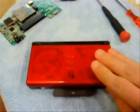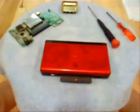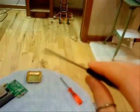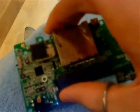So your only other option — don't fret — is to take a new DS Lite BIOS chip and install it in your DS right here, replacing the BIOS in your Nintendo DS Lite. This sounds complicated, but it's really pretty simple. You're going to need: a tri-wing screwdriver — you can buy these at dealextreme.com, they're pretty cheap; a small Phillips head screwdriver, also easy to buy online; a tray to put all your screws in; a pin to pry apart the various components; and a replacement DS Lite motherboard or a replacement DS Lite BIOS chip.